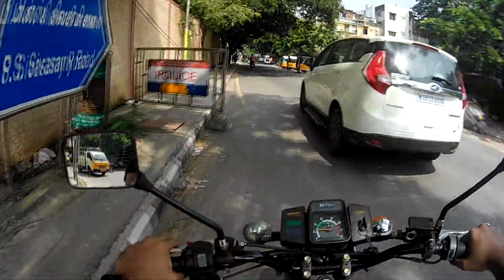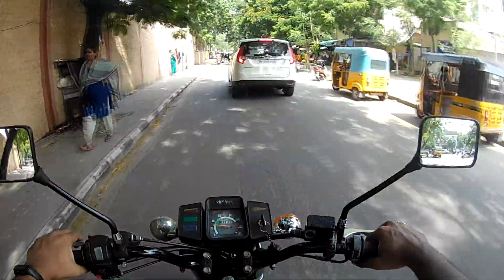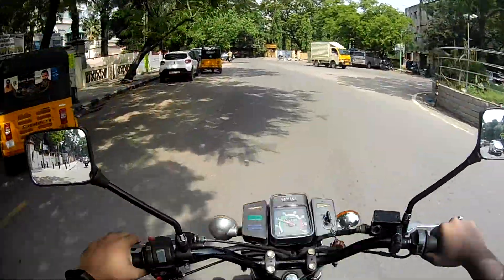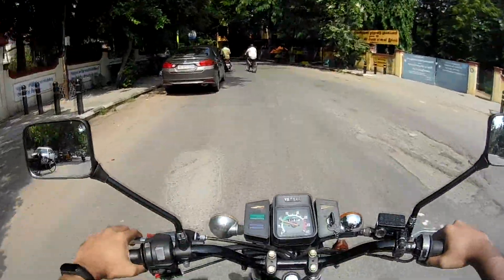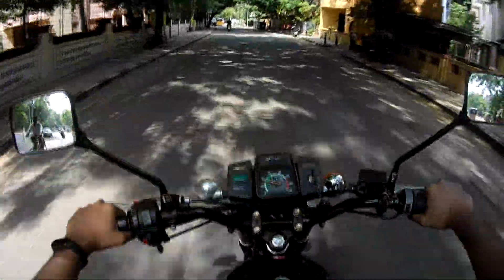So what I did was I went with a 135 four-speed setup, that is a 16 teeth up front and 34 teeth at the back. I had another idea of sprocketing with the RXD's original setup, that is 15 teeth at the front and 37 teeth at the back, but unfortunately it is not available anywhere, so I had to stick with the 135 four-speed setup.